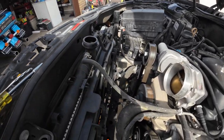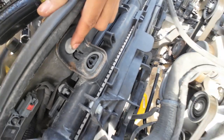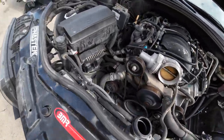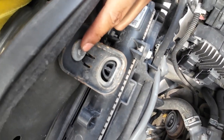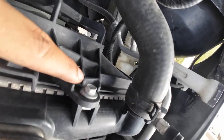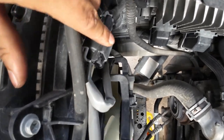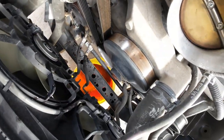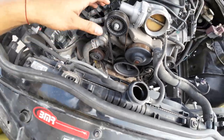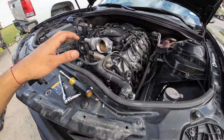So we've got a bolt here that's going to come off — this is a bracket bolt. This hose is going to come off, so we'll disconnect it here and also disconnect it from the water pump. Obviously the bolt repeats itself on this side here. We've got the fan bolt that's going to come off — there's another one, it repeats itself over here. That fan bolt is coming off. And then we're taking this off — this is the power for the fan, that gets disconnected. And for now that should be it. Then we'll take this radiator and move it out of the way.